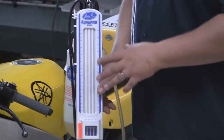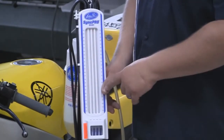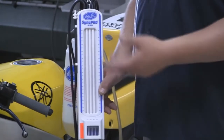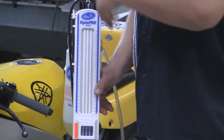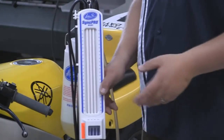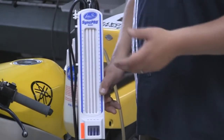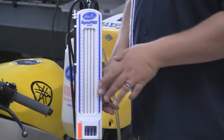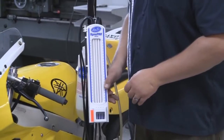The SyncPro is a really nice and compact unit and it has four channels to indicate up to four cylinders of intake vacuum. On a six cylinder bike you could synchronize just four at a time and then synchronize the other two to some that are already synchronized. So it's a very versatile tool. Each channel is completely independent, so if you had just a V-twin with two different carburetors, all you have to do is connect two channels. You don't need to block off the other channels.